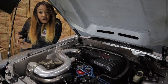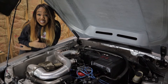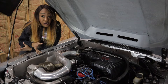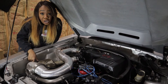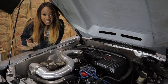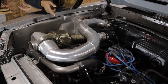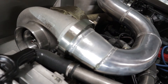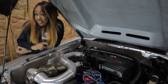That's why I couldn't put an intercooler on the car. After driving the car, getting it on the dyno, and looking over the logs, I realized my car really doesn't need an intercooler for its current engine and power setup. I have a 76 millimeter Precision turbo, which is a little big for a 302, but I bought it with the intentions of growing into it. Also, being on E85 helps keep things cooler since it uses much more fuel than 93 and helps cool off the air in the cylinders.